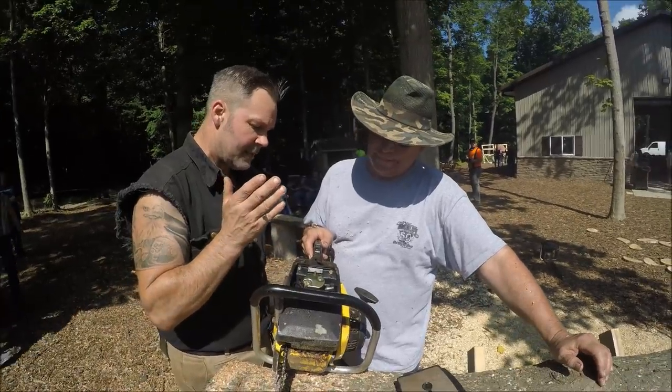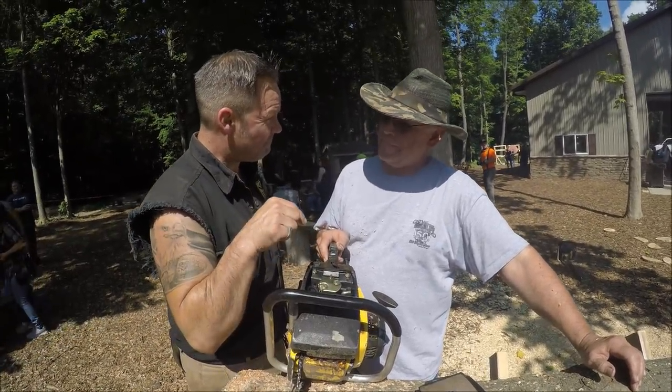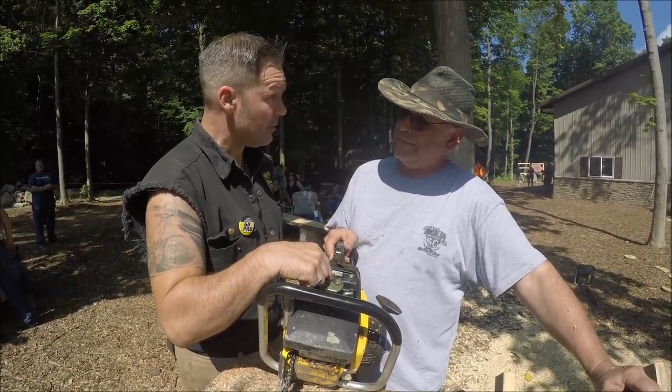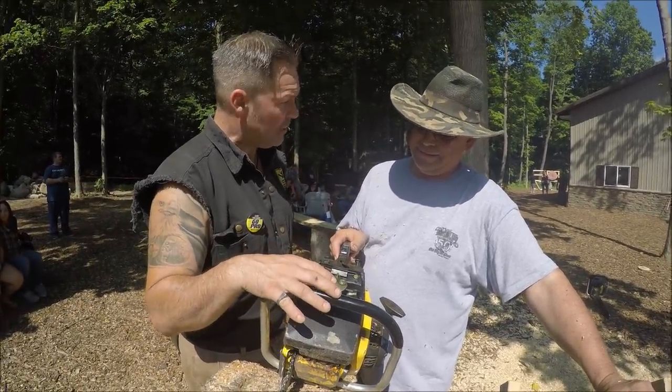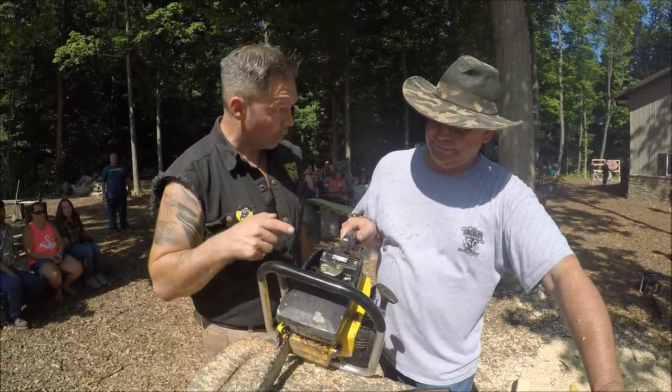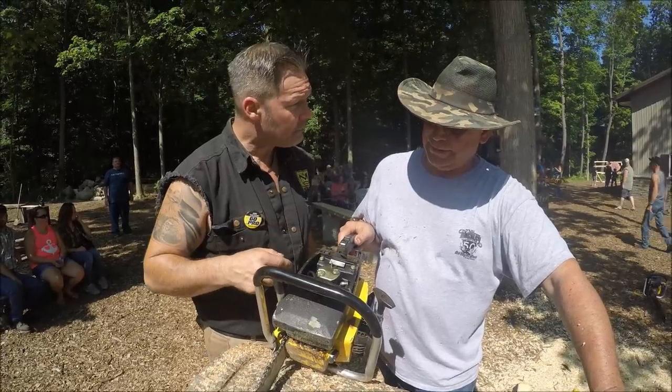But my 125s, same thing. I took one off. They'll only let you go so far. And that's great, and the saw will live forever. But me and you know how to run power saws, and we know how to file chains. But guys that don't will burn the saw. That's why they did that, in my opinion.